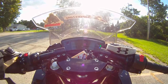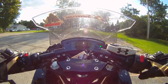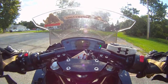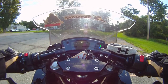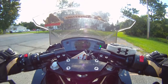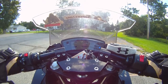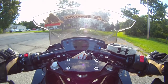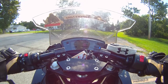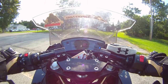But yeah, so third time. I'll do it for real this time, but I don't give any gas. So my hands are on. I always usually like to pull the front brake in before. That way, put it in first gear, let go of the front brake, let out. See, now I'm going. See, now I'm stopped. Go, stop, and I'm barely letting it out. So I'm letting it go.